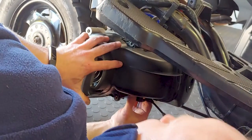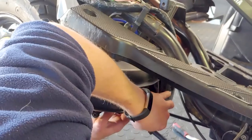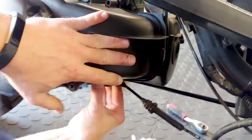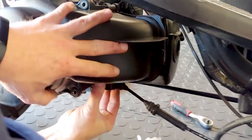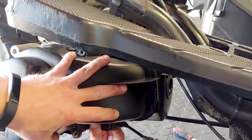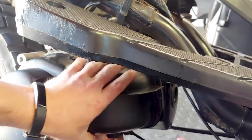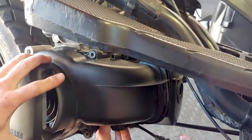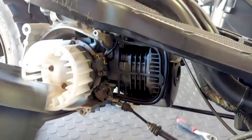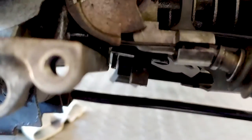The two-stroke pump cable is what you use to locate everything. If something is not allowing you to align the cowl, something is in the way. In this case it can only be two things: the two-stroke pump feed to the pump, or the one that goes to the carb. Generally it's the big one on top. You often have to use your finger just to bend that little clip — the male-female connector can be an issue.